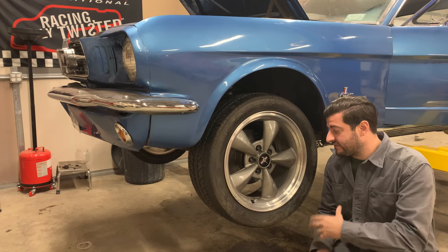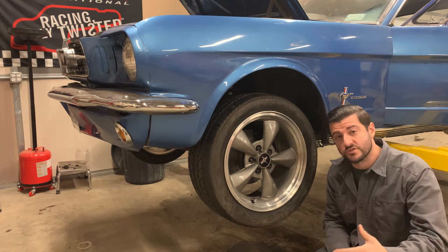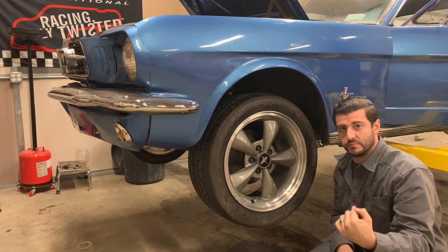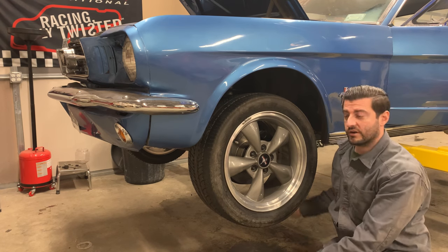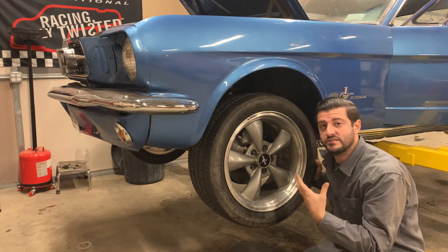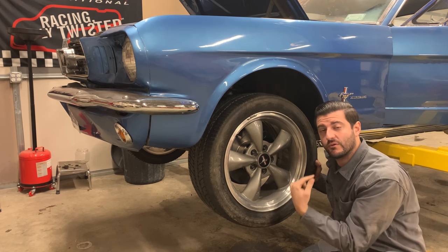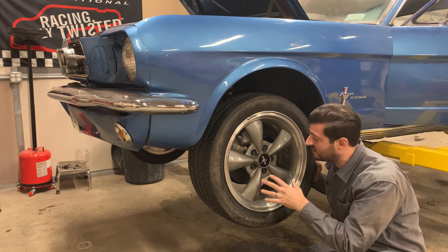The brakes are all on - front, rear, everything's hooked up. As we started to bleed it there were a couple of spots where it started to leak, so we just tightened down all our fittings. It's not ready to test on the road yet because there's three feet of snow. We bled them right rear, left rear, right front, left front. We spun the wheel hard and hit it - it worked! These lock up - they grip better than the rears. You can adjust the pedal if you want less or more pedal travel. It's just manual brakes still, but I think the manual brakes should be good with this setup.